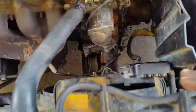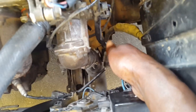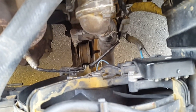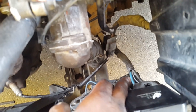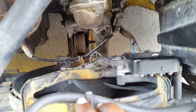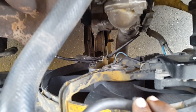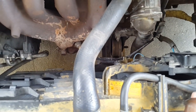Another small upgrade I did was modifying the fan controller — it has negative and positive here. I got rid of the center line: once you cut this small wire in the center, the fan goes into a safe mode where from the time you turn the key the fan will be on all the time. I just severed the blue line going straight to the ECU, and the fan runs all the time from ignition on. It's a high compression build at 10.5-to-1, so keeping it cool is very important.